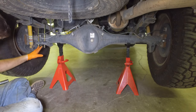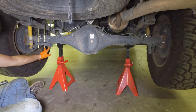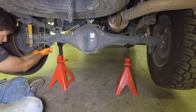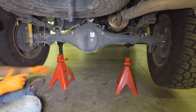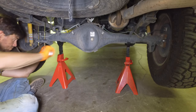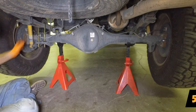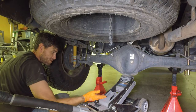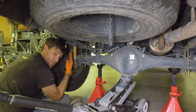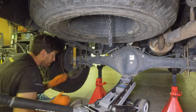One thing that happened was when I tightened it up, it seemed like one of these bolts was a lot longer than the other side. So I loosened that side to try to spin the cradle around the axle a little bit more — rotating this lower mount around the axle to try to make the length of these U-bolts seem similar. Shocks are on; it just took a little bit of lifting to line everything up. Once again, we know these shocks are not long enough and you should actually go get longer shocks. I'm not sure which ones yet — I will probably put it down in the show notes. I need to do some research.